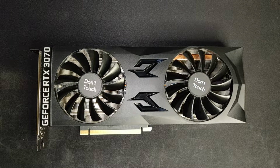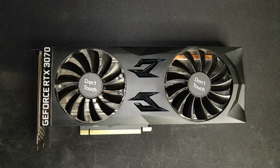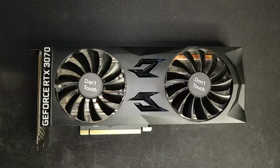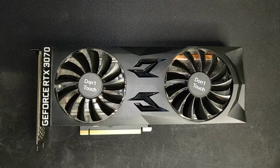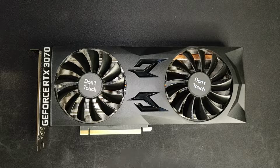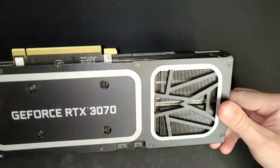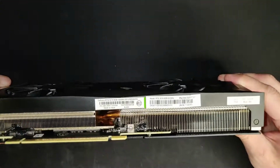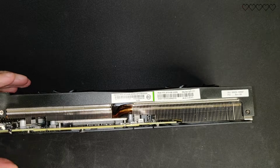So I recently bought a used RTX 3070 that is originally from an Acer pre-built, and the card suffers from really bad thermals and extremely loud fans. While gaming, the card's temps rose to around 90 degrees, and I tried to fix the problem by undervolting and making a custom fan curve, but it still wasn't enough. So I decided to deshroud the card and add 3 Arctic 92mm fans to it.